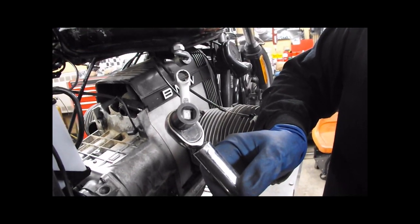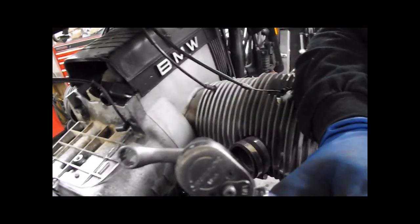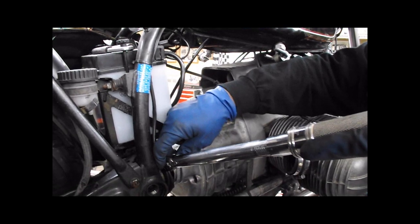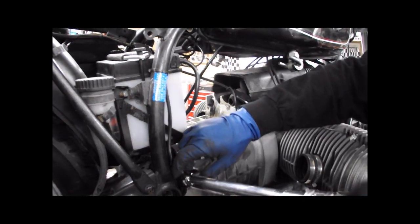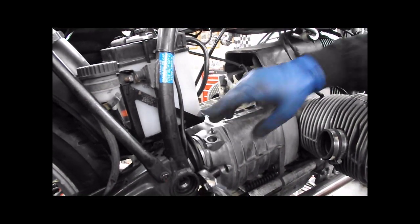Once you have the 4 bolts into the drive shaft flange, you can now torque them. This is the special adapter from BMW, which you don't have to use, but if you just use a wrench and your drive shaft bolts fall out, don't write to me crying that it's all my fault. We torque them to 32 Newton meters.